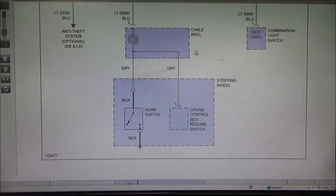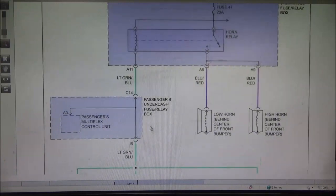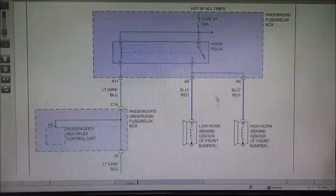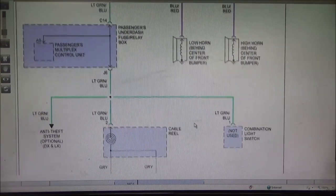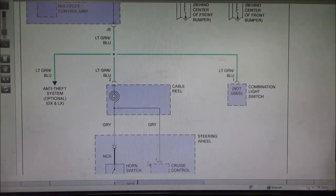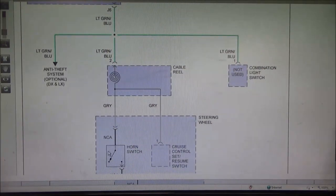The easiest thing to do here is pop the hood, find this stuff, bypass the relay real quick, and make sure the horns have the ability to blow. If they do, we'll go hopefully right to the clock spring and see if we have a bad switch or a bad clock spring — which is what I'm very suspicious of, simply because she said she noticed all these problems happening at the same time.